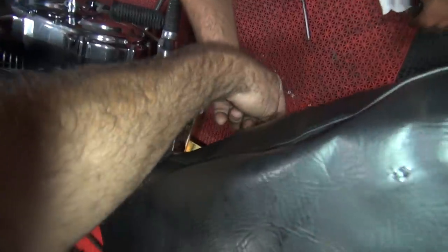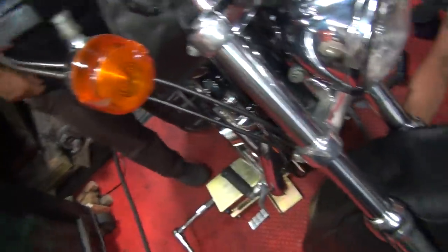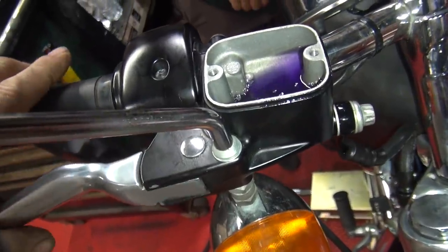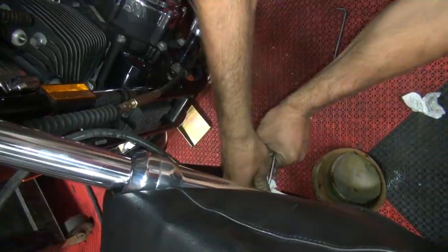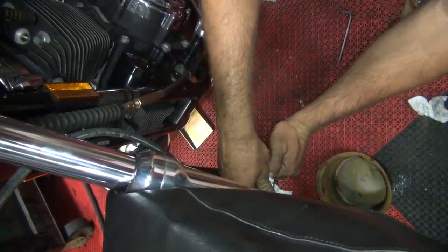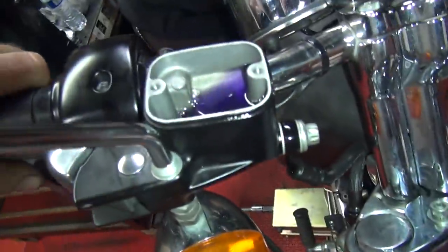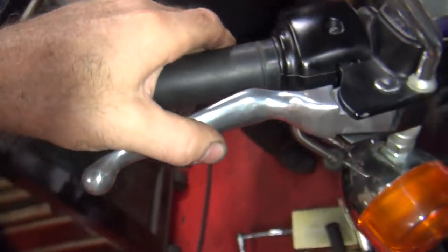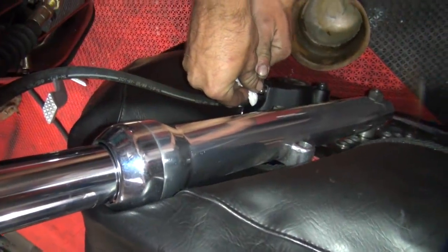The screw is going to go up, so if you put a wad in front of the screw it'll catch a lot of it. On top of the screw, that's where it's going to come out. Okay, so let me know when you're ready. I'm ready. So now we're going to pump it up here. One, two, three. Okay, I'm holding it, so pop it. I want you to loosen it instead of tightening it. It's going down — stop — lock it down. Yeah, tighten it up. Okay, don't break it, just tighten it. So you have to hold it down here until he's done. Are you done? Is it tight? Yes. Okay, let go. Then we come out. Pull some more air out there in a minute. So you've got a lot more pedal on it now. Did we get any fluid coming out when I did that, or just air? Just air.